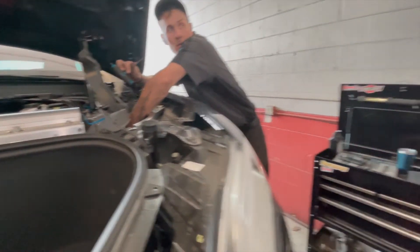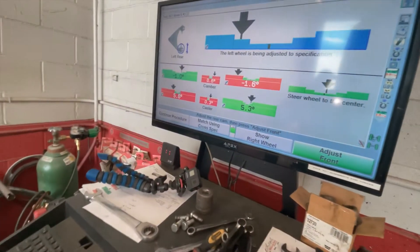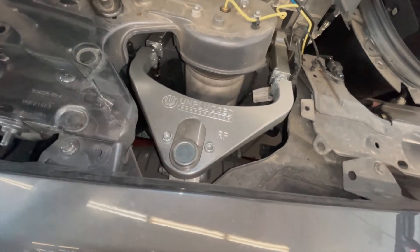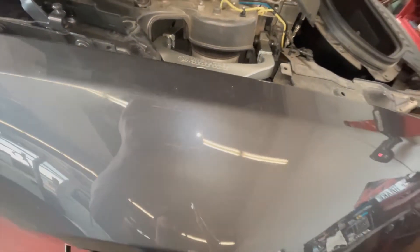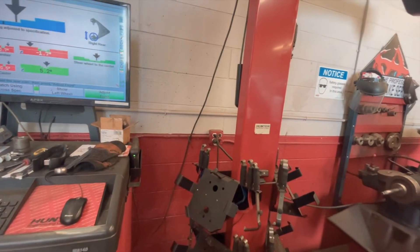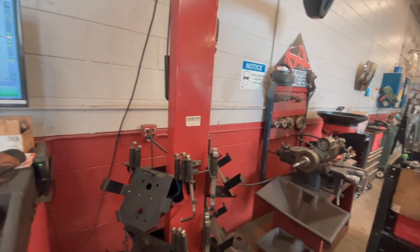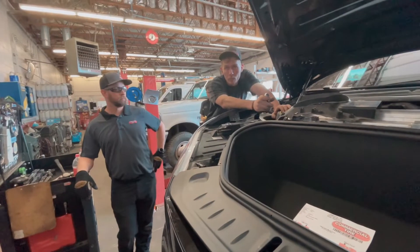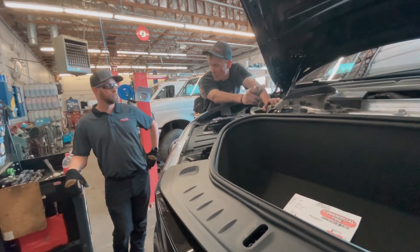Camber was adjusted by that rear bolt — it's now sitting at negative one degree of camber. When you flip the pill over in the future, that adds negative two degrees of camber to whatever setup we have now. We're going 5.7 on the caster; it's supposed to be 4.7, but the adjustability doesn't allow much more up top. So we're going to go down below. It was 5.4, 5.5, and it was completely maxed.